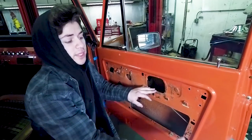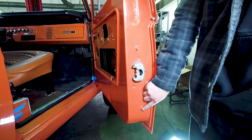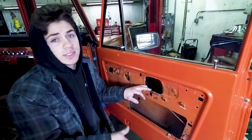Now what you want to do is get the rear window track out of the way. Make sure your window is rolled up, then unscrew the 2 bolts at the back of the door. If your window track is broken, now is a good time to replace it. A link to that part is in the description.